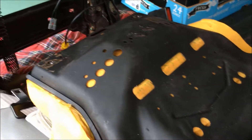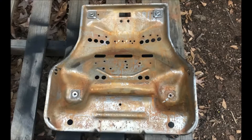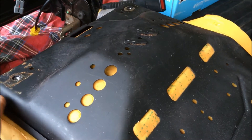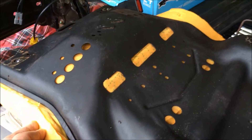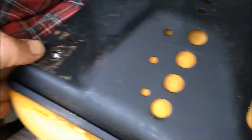Another quick tip while you're doing this: this pan the first time I took it off was absolutely covered with superficial rust. I can't stand rust — it was easy to clean off and then I used a rust reformer like Rust-Oleum. After I cleaned it and made sure it was degreased, it comes out pretty nice, though you can see some rust has come back.